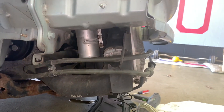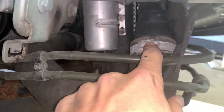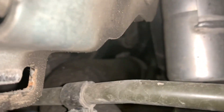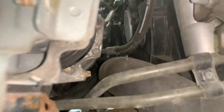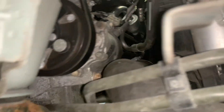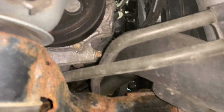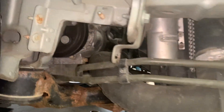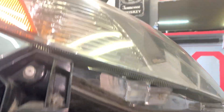The passenger side is a little trickier. You have one hose clamp right here that's easy to get to — that'll fall right out of the way. The second is tucked away back there, squeezed in between my radiator fans and what looks to be part of my transmission. In order to get to that, since I'm not going to be removing the radiator, I'm going to try to jerry-rig something and drop it down from the top.